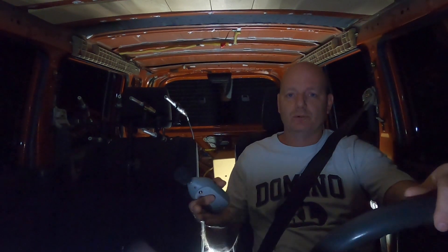Now we have our measurements — we can use these as our reference going forward. Our A-weighted noise measurements are 48 dB at idle, 76 dB at 60 miles an hour, and 71 dB at idle with the compressor on. Now let's take a look at our RTA measurements with SysTune.